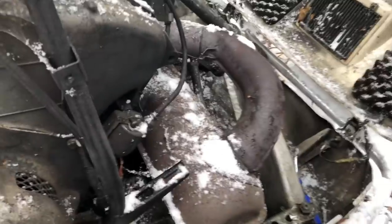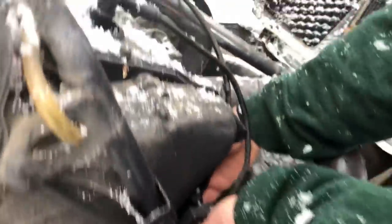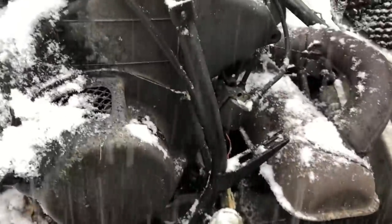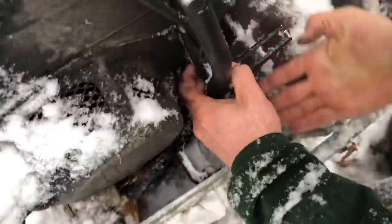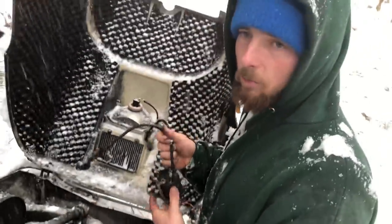Alright, there's that washer. Now there are two coils, and there's this little exhaust shield back here that should come off — you gotta get these screws out, it's a little bound up. There's that exhaust shield. Pull these two screws out and those guys are now free. It doesn't matter what side is what with the coils right here — we just need to match our wires up on the other snowmobile. We'll unplug these two little plugs down in here — there's one, and there's two. Now we'll take these down and go put them on the other one.